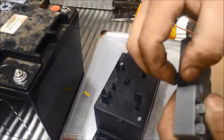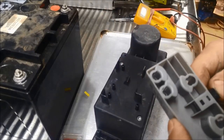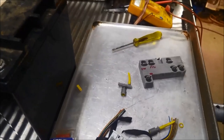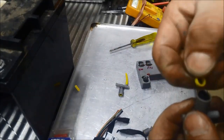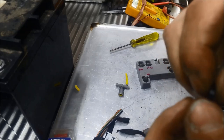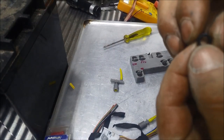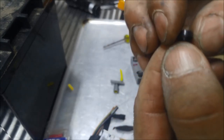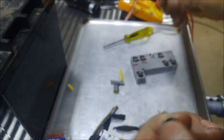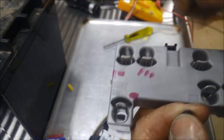There's a little clip there, so it locks it in when you're pulling it in or out. It just locks into that little tang there. Now if you have a leaking hose, just pop out this little plastic holder there, retainer, and you'll find there's a little O-ring underneath. So if that O-ring, it is a square cut one, but you could probably use a round O-ring as well. You just need to get the right size. And it's a good idea to test that they're sealing properly before you put this on. It's a little bit hard to decide whether it's sealing properly or not if it's going through that.